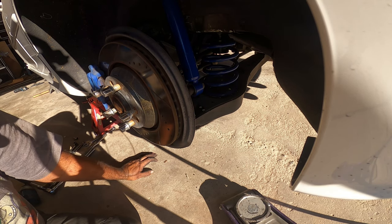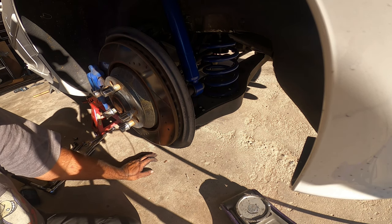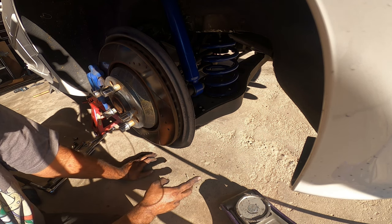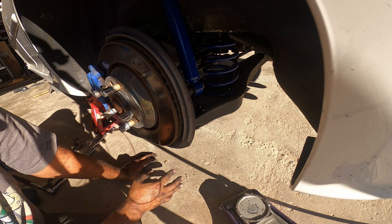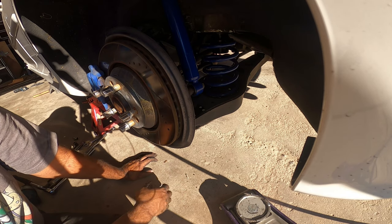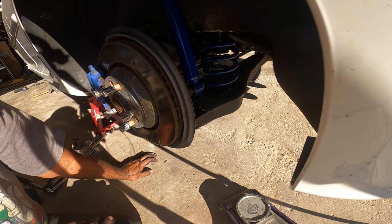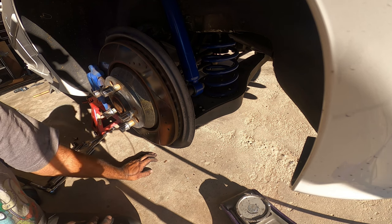And voila — you've got the front and the rear done. I'm able to do this in under three to four hours, removal and installation. The biggest key in this whole process is making sure you have a jack, and making sure you have new hardware or new bushings for the front — that saves a ton of time because removing the old strut and rebuilding it is a process. I set it about seven threads down, which is about half an inch of space. I think that'll be just enough so the car won't be too low or too high — much better stance than before. Let's get it all tightened up and see what it looks like.